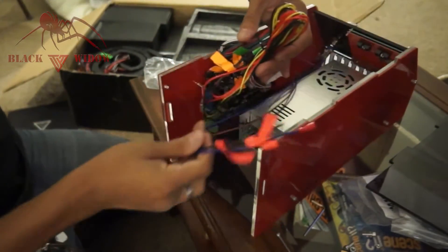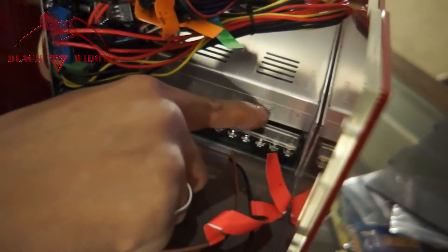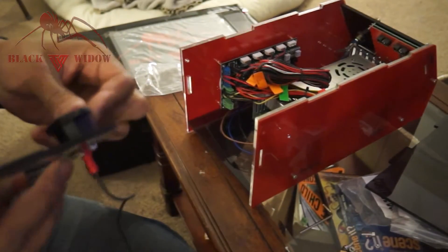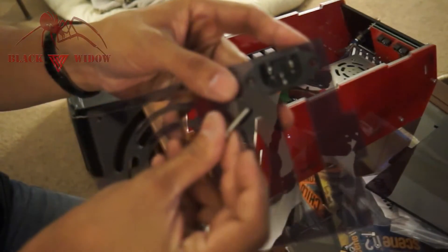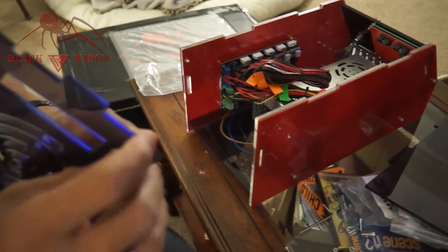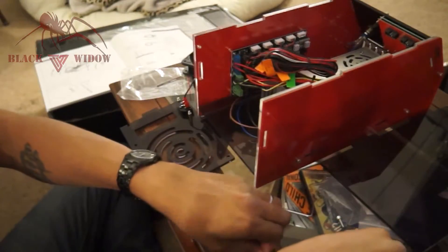Now we got the main board on. Pull the wires through underneath — the N and L wires go to where it's marked on the power supply, N and L, and the blue wire goes to the plug. One more thing: add the black wire plug through the back — it's a snug fit. Then put the longer thin screws in and secure them with the two brass inserts. You can lock them with nuts, then close and tighten with the Allen wrench.